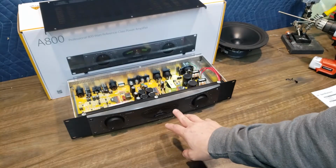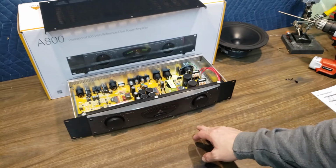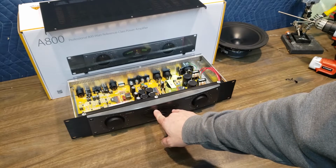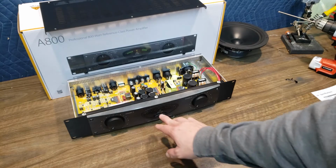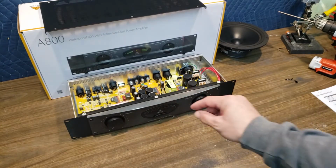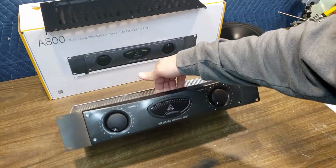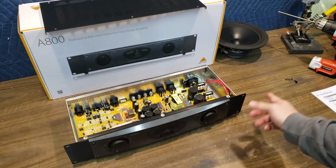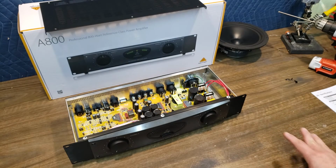And where the Marantz does have a little bit more room and will get louder, this will too. And I can't tell if the Marantz is clipping or not because it doesn't have meters on the front. This one, by times, if I'm really rocking out, having fun, sometimes I just like it really loud, I actually push this thing to just start touching the clipping. And I did not think that would be an issue with a 220 watt times 2 amplifier. It's kind of the whole reason I got this. So either maybe I'm doing something wrong, I don't think so, or it's just that wattage and power is not linear or whatever.